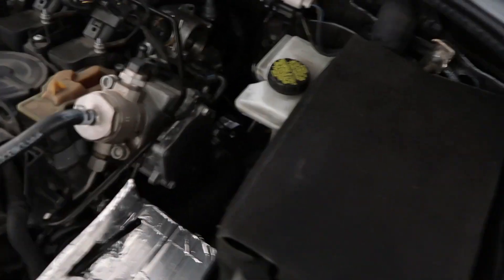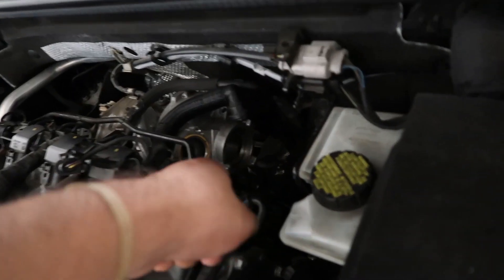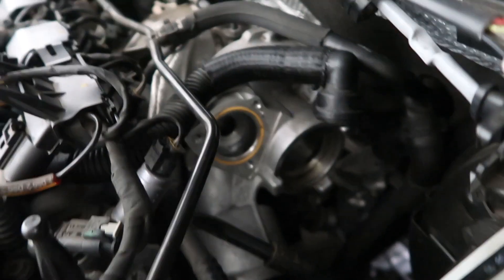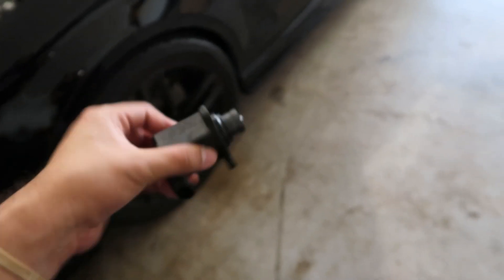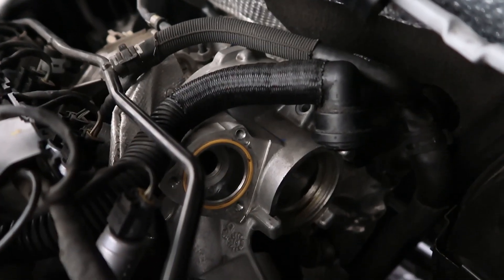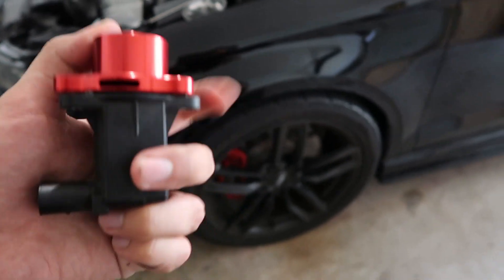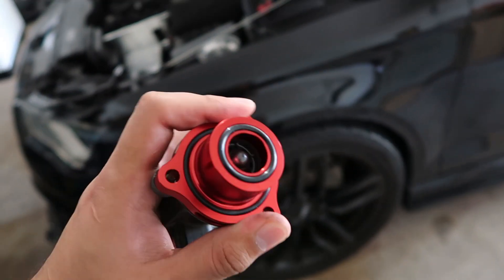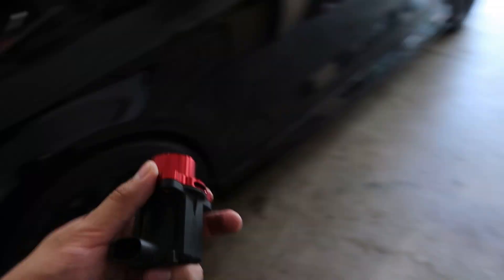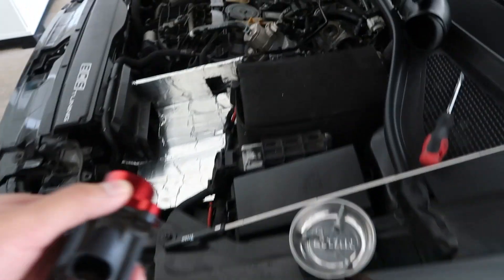Alright guys, so I went ahead and removed the intake and the inlet — removing the inlet makes things easier because it gets in the way of a final bolt right there. So as you can see, I removed the valve right here. It's attached with T30s — yeah, they're all T30s, and the bolt for the inlet is also T30. Remove it, move it back, and you can get to that bolt and then remove the valve. You just put this diverter valve right on top of it. It'll have a little space where you fit that little nipple in and just clamp it. Use the bolts that come with the diverter valve because they're a little bit longer — don't use the stock ones. Just use the ones that come with the kit and do everything in reverse.